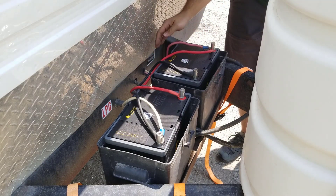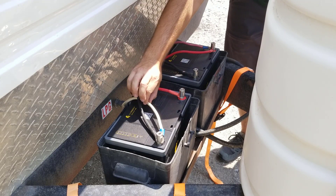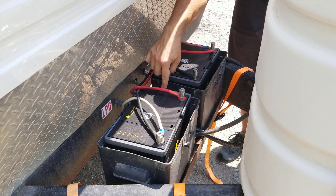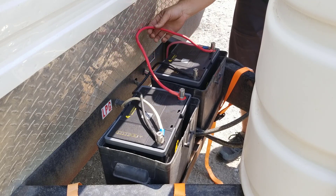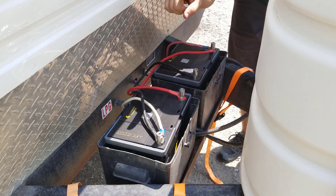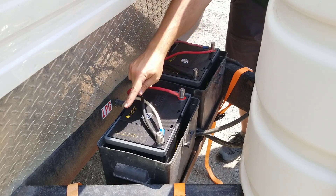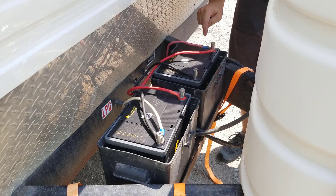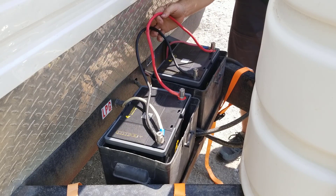The few basic connections you need: I have this red, which is my RV main positive, and this white, which is my RV main negative. Because these are two batteries at 12 volts, we need to wire them in parallel. So I have this red cable going from positive to positive, and this black cable going from negative to negative. Then the negative RV main cable goes to the negative on battery one, and the RV main positive cable goes to the positive post of battery two. And just like that, we have a parallel connection.